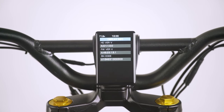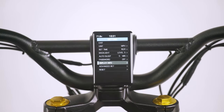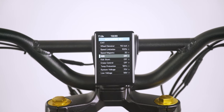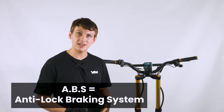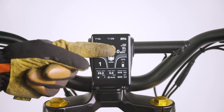After password, you have display info — not too relevant, but you'll go in there if you need specific serial numbers. When you try to access the advanced settings, you'll need to input the password you just created. Some settings you can change in the advanced settings are cruise control, kickstart, and ABS. These all default to off, but you can turn them on in the advanced settings. You can tell whether cruise control and kickstart are on by seeing if those symbols appear on your front display.